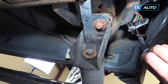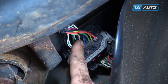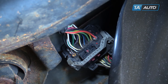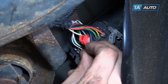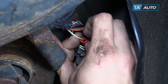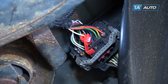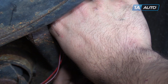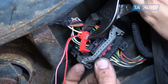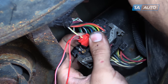In order to make the lights on our new tow mirrors work as running lamps or marker lights, we'll have to use the second of the white wires with the yellow tracer. From the latch side of the connector, this is going to be the fourth one in from the left. Install your double barrel crimp connector onto the wire. With the leads from your mirror, stack one on top of the other. Install them into the other side of the double barrel connector. Crimp your connector with a pair of pliers and close the safety latch over the top.